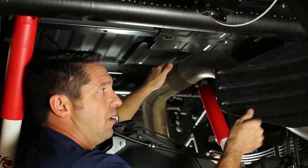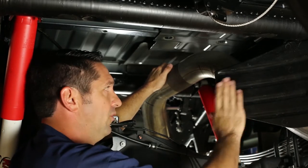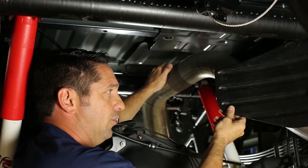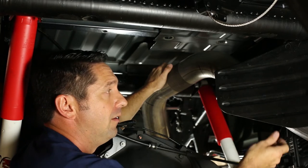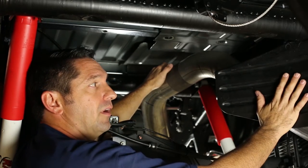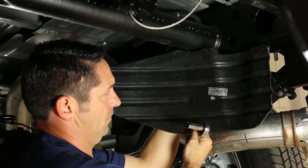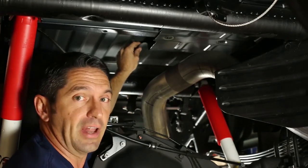Speaking of clearance, some models will have a spare tire heat shield between the tailpipe and the spare, and if this is in your way — especially if the truck is on the ground — only two bolts with 13-millimeter heads hold this on the truck. Taking the time to remove those two bolts can give you some extra room to work. So let's go ahead and get this heat shield out of the way.